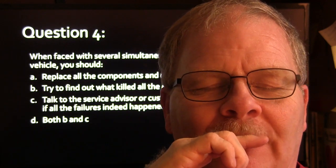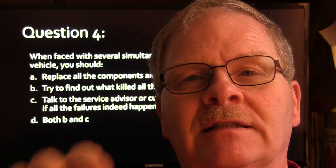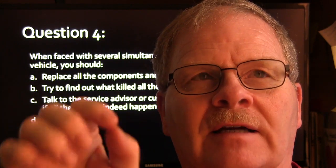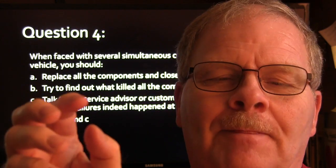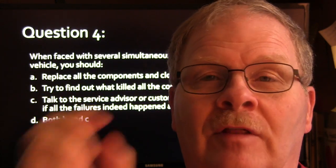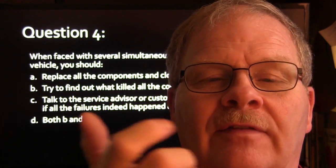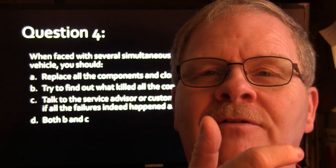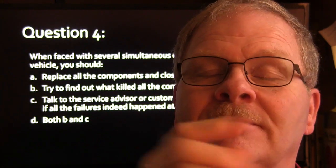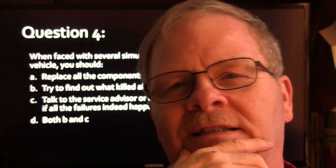You know, I don't know what they did to change the programming, but when that square EVP sensor was first put on there in the early 80s, this was an 84 model, by the way, not a 94. If I said 94 earlier, I'm sorry. But anyway, if we saw that square thing on there, we would pop one of the round ones on there because they didn't do what the square one did. But that thing could cause the car to stall. The idle tracking switch not being good, having resistance, could cause it. And the throttle position sensor, I got codes for all this stuff.